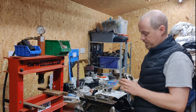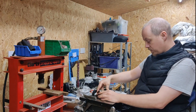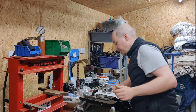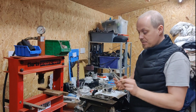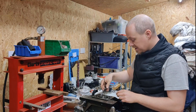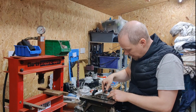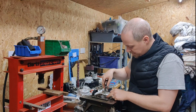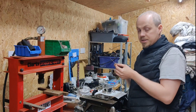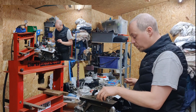I'll take my used Cooper S piston, make sure the ring is fairly central, and just tap the ring in. There we go — it doesn't go any further. I know that ring now is parallel to the top, so I can take my feeler gauges. The bottom tolerance is 0.2 and I can check the drag on that. There's plenty there, so I'll go to the top size. I can feel that it's starting to drag, so I'd say the gap is about 0.38 for my first ring. Once I've got that ring done I continue to do all the remaining rings.